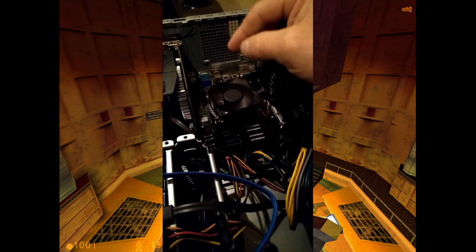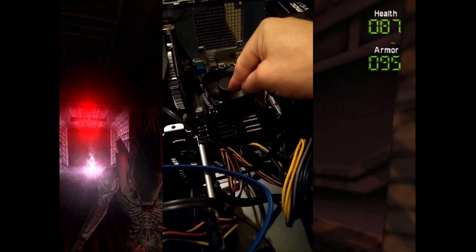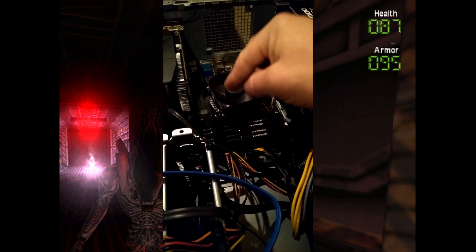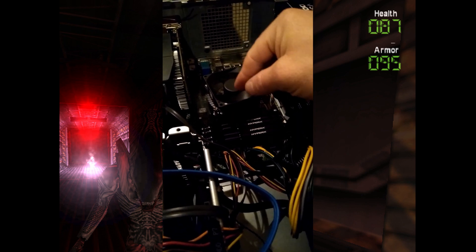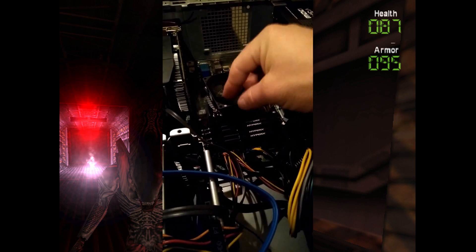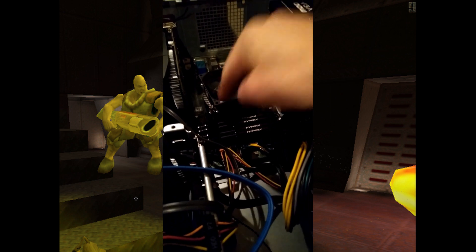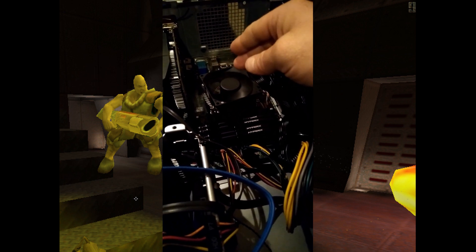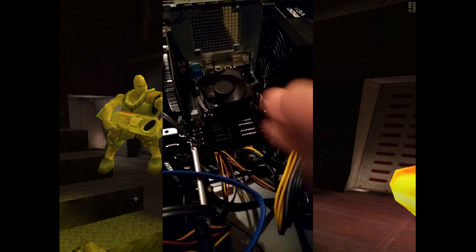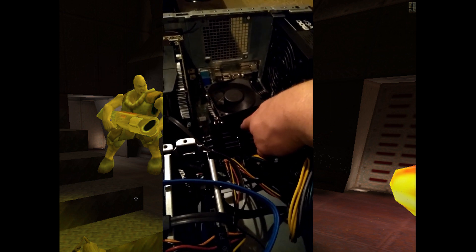Holy crap — I can't even think right now because it's working and I'm happy. But basically my last ditch effort was to pull the fan off and pull the processor out. And sure enough, there was some fuzz or some other gunk in the processor that I had to clean off. When I cleaned it off — bent pins in the processor, that's what I was thinking. But the fuzz was in there and I was like, oh crap. I got as much of it off as I could, but there's still some of it gunked up in the pins, stuck in there, and I'm not touching it — I'm not bending any more pins.